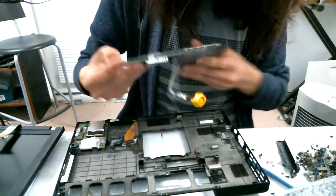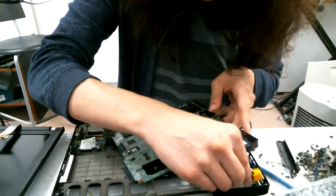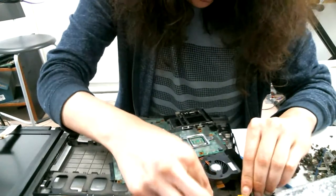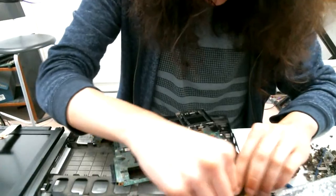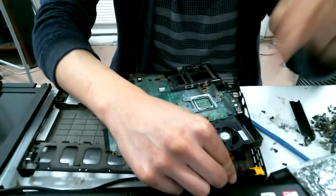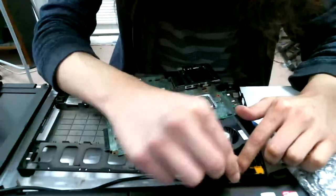And now we could just repeat the process of putting it back in the motherboard. But first, I would actually screw this down here. So the power jack on the X200s is actually held in by the screen and the bezel slightly. So because of that, it's just going to be loose for a bit. There's also a ground connector, which you just kind of screw in. So let's see if I can show that off a little bit more. What the ground connector kind of looks like, a little steel cable by my hands.